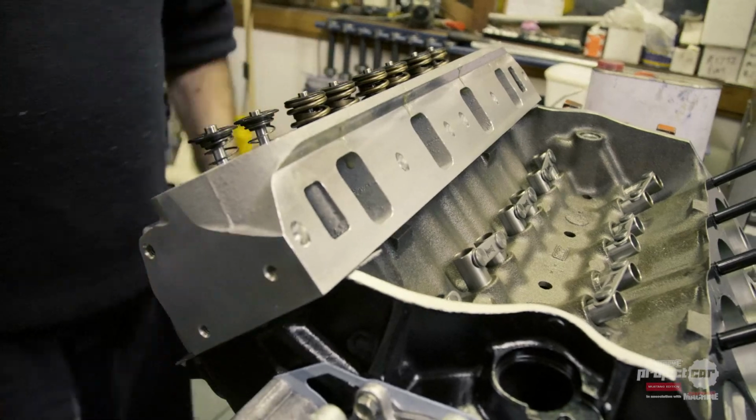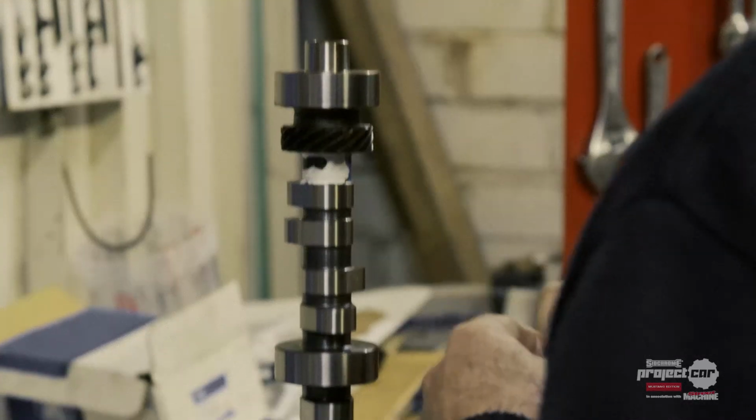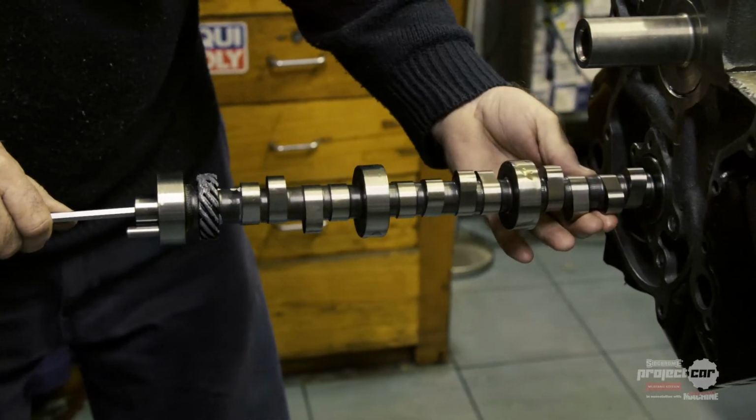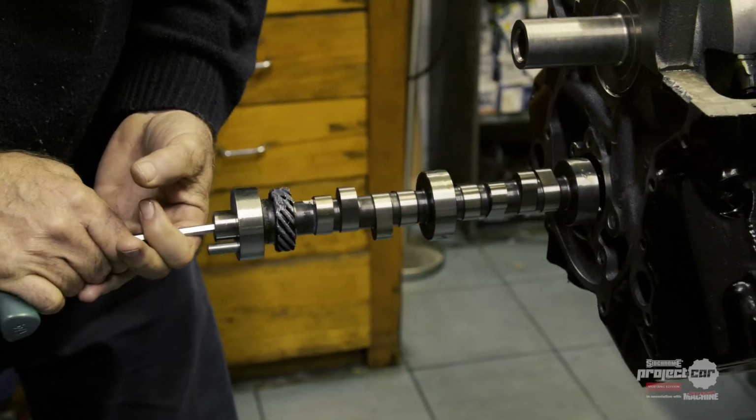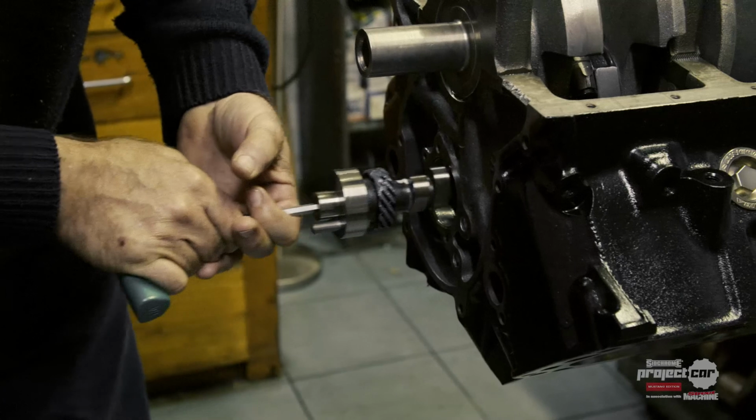And what are we going to do in terms of cylinder heads? Cylinder heads, there'll be an aftermarket aluminium cylinder head, and we'll remachine the surfaces and basically recut the seats. So with your camshaft selection? Camshaft selection, we decided to go with a hydraulic roller cam with around about 230 duration and 235, and with the hydraulics it's just maintenance free.